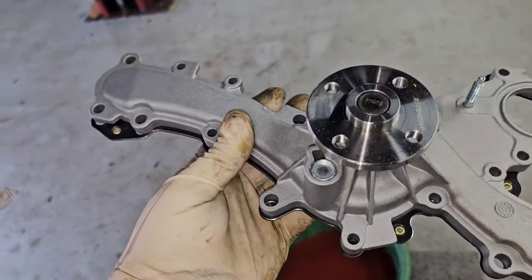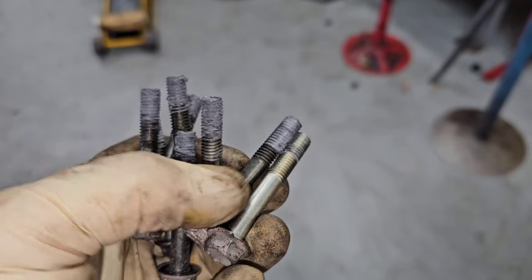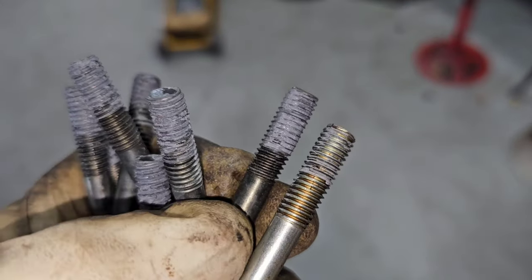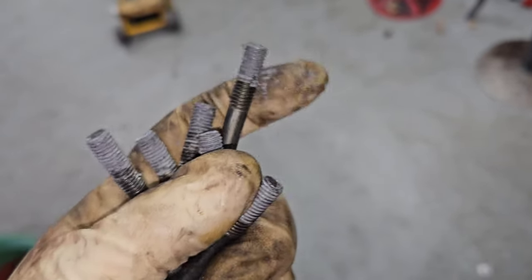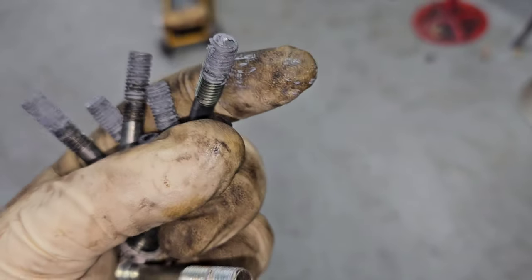One thing that's a little tricky — you kind of got to hold the gasket to the pump and just get it up in place and then start catching bolts. Now here is something quite interesting: some of these bolts that go through the water pump go through the timing cover and into the block itself. They have gray silicone that was used on the timing cover — and it's still wet in the threads. If you think about it, it's like being in the tube with no air, so most likely it stays wet, especially in a large amount. Surprising still from 2015, as far as I could tell this thing has never been apart. Also, if you ever get silicone stuck on the bolt ends like a little nipple of silicone, clean it off — because that can hydraulic as you put it in and actually break the cast aluminum.